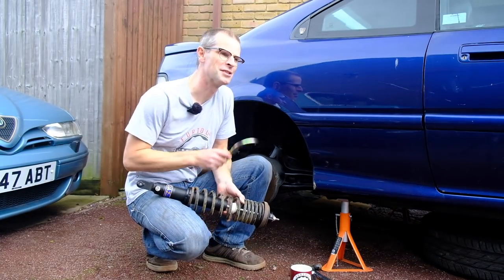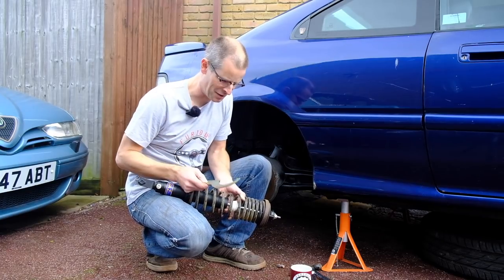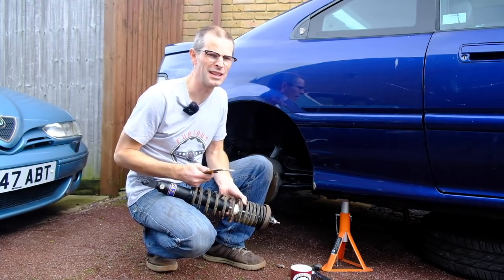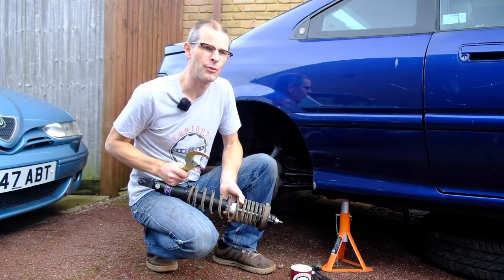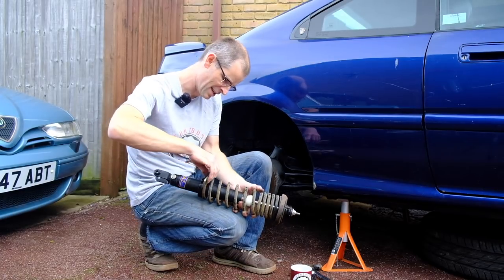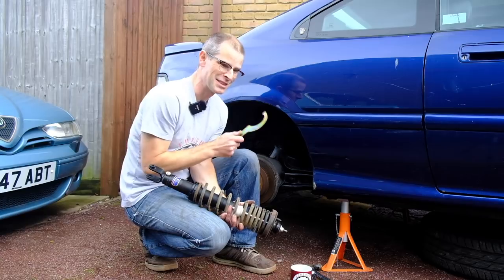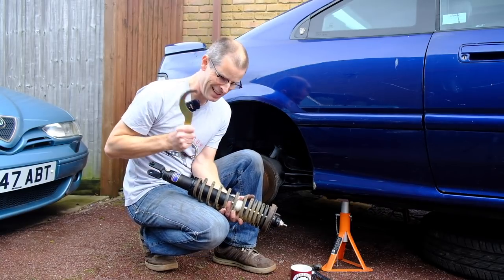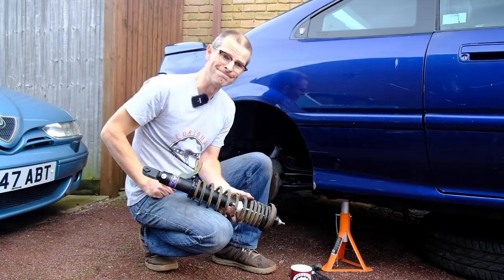It's actually a week since I started doing the fronts. I had to take a slight pause because I'd lost these things — I couldn't find them anywhere. I had one when I took these things off the car because I thought about taking it with me to Gaz, but I left it somewhere at home. When I came to fit the rear shocks, you have to wind the spring up a little bit higher to clear the lower anti-roll bar, and without it I couldn't do a thing. Fortunately, Gaz posted me actually two of these now, so I can get these things adjusted enough to fit into the car.